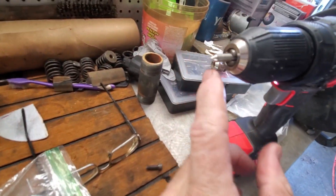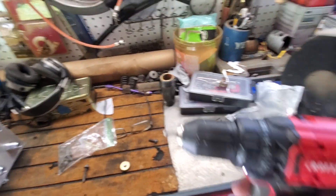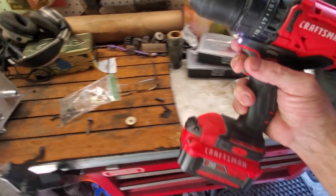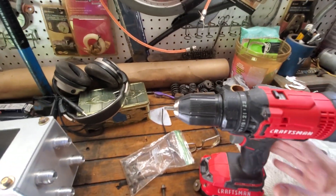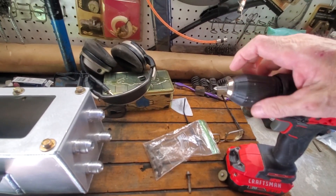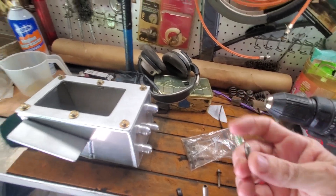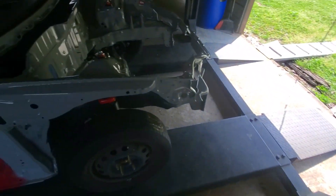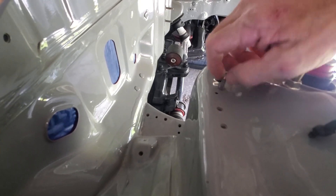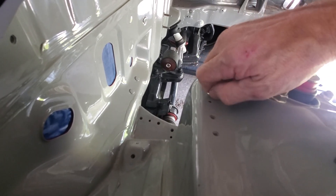What I did here is I put that piece that I cut off in the drill, and I just turned it as I sharpened the tip. Just as simple as that. Now we'll take it out — I barely tightened it because I don't want to mash up the threads. It should still be pretty clean. We're going to come over here, set that in our hole, and screw it in by fingers. I want to make sure that it goes in freely just by my fingertips.